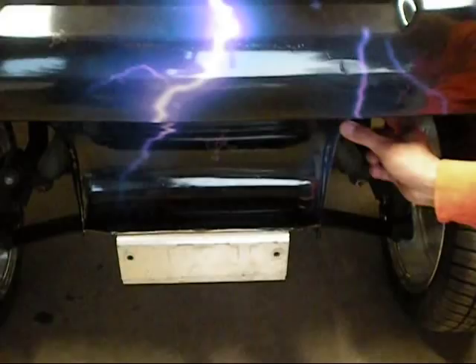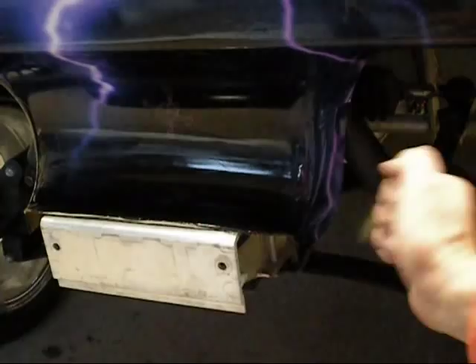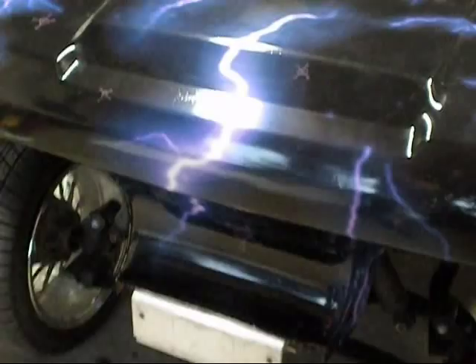One of the things you may want to do is take a piece of scrap, and in these sections down here on the bottom, before you do your application, take a piece of scrap, trim it to the edge, lay it down first, and then do your application and pull it over. That way you have a cleaner install with less obvious seams.